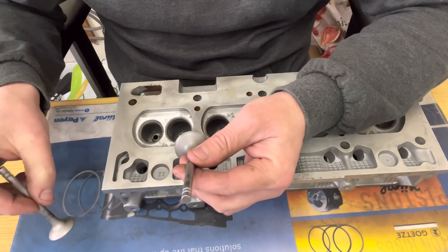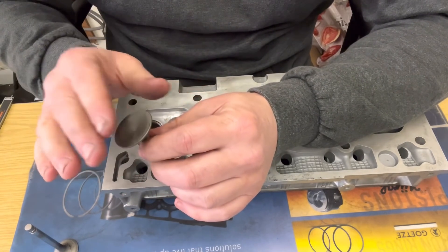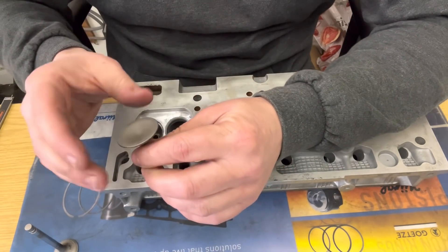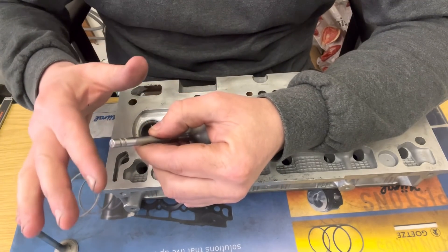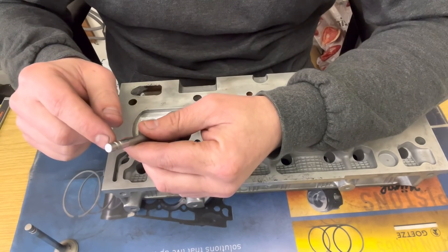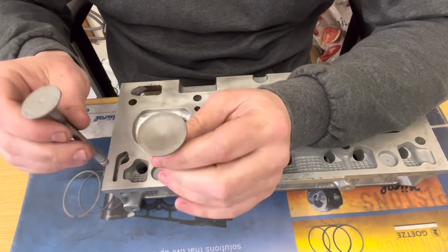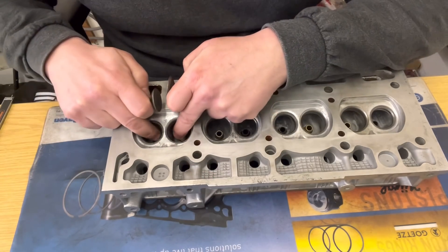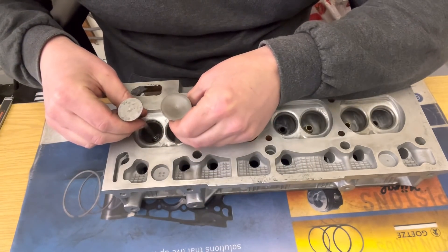What we've done in the past is look in our catalogue and find bigger, longer valves. We've customised the length of the valve to what we want and actually cut our own collet grooves in them. That is exactly what we're going to do with this. So the process starts by taking two original valves, which we've put in the guides.